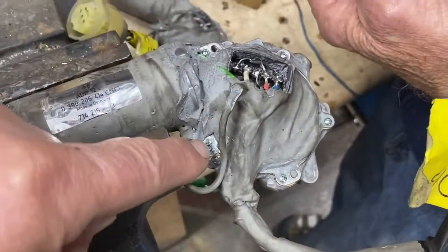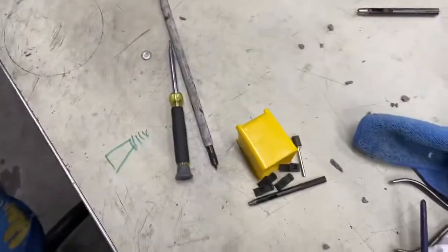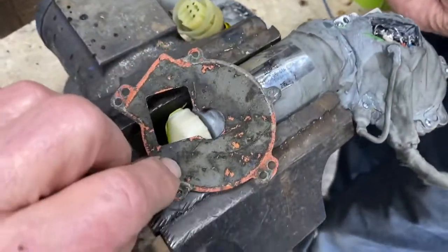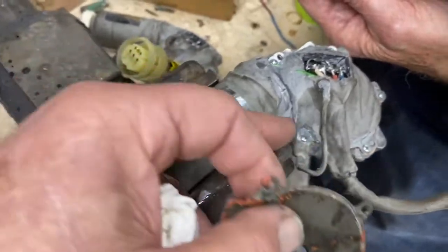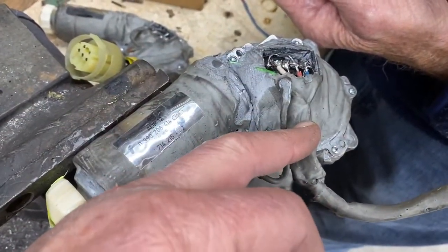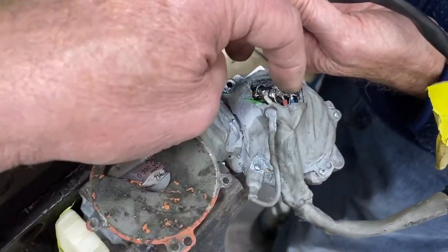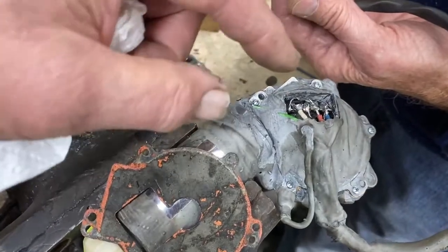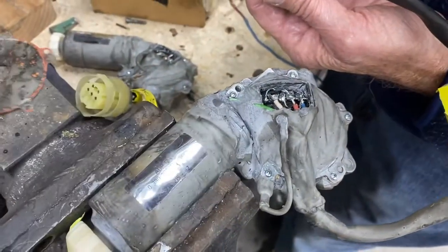What we've done is we've drilled off all of the original swedge die-cast rivets around the perimeter to be able to lift the lid off. Inside, the culprit on this particular unit is this gasket, which was originally a rubberized coated gasket. This rubberized material just gets old after a while and falls off inside the commutator brush mechanism, getting between the spring-loaded three contacts right directly underneath these three terminals and the flat steel plate that rotates with the motor. This rubberized material is actually fused onto the plate as an insulator and completely ruins the function of the unit.